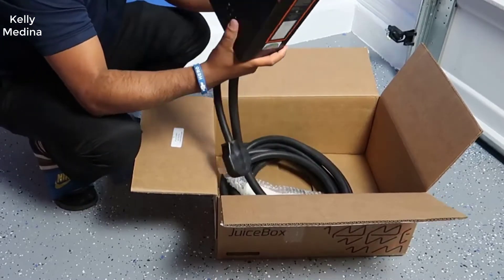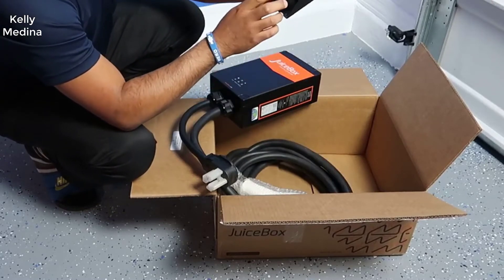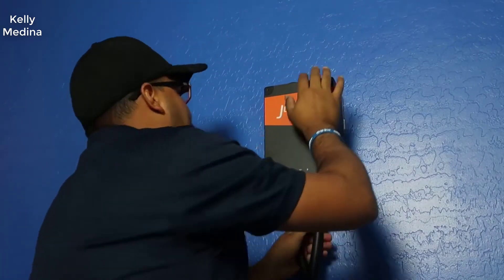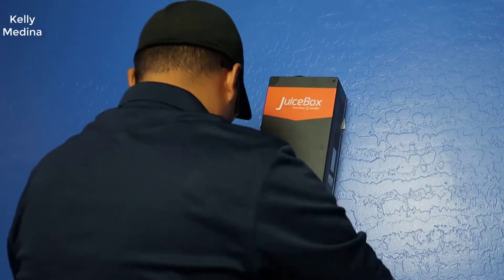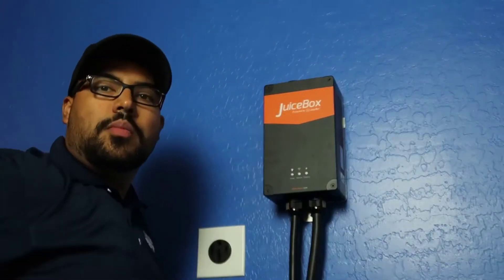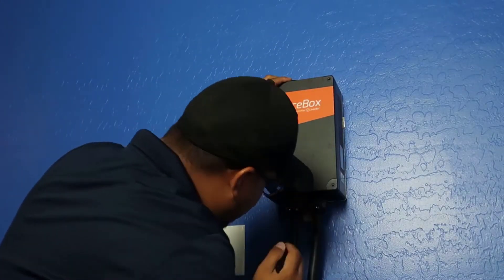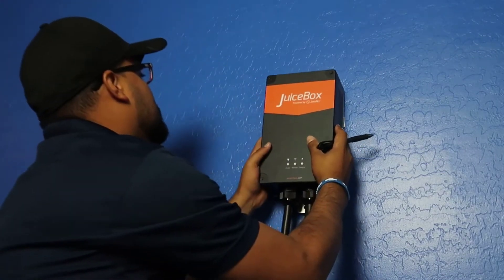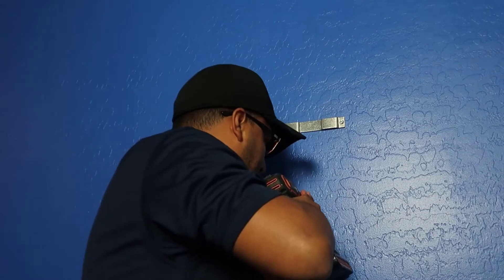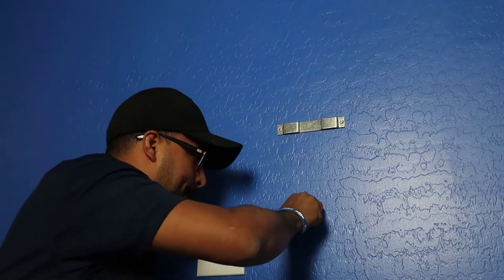There may be a few oddballs out there, but nothing in the United States. If you have an electric vehicle in the US, it will support 40 amp charging. The big question is probably how much faster is it than a standard 30 amp charger. Well, based off my observations and calculations, it's about 30% quicker. So what normally would take you an hour to charge, you would get the same range with 40 minutes of charge. Or another way to look at it: whatever time it takes to get 100 miles of range, that same time you'll get 130 miles of range, which is actually a lot quicker.